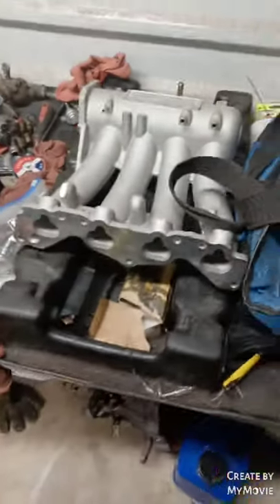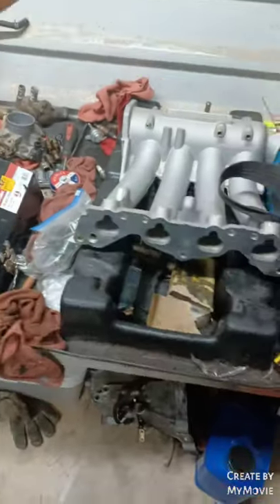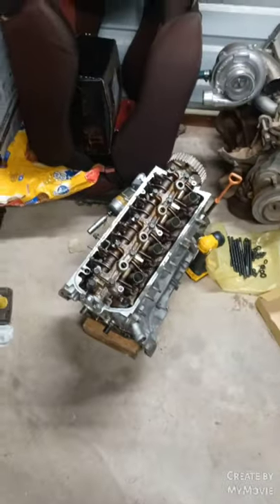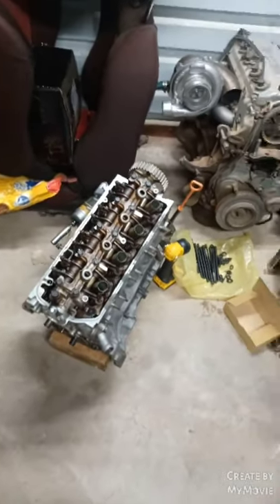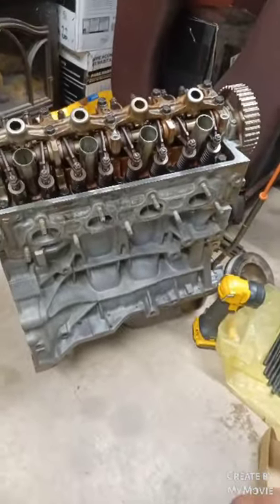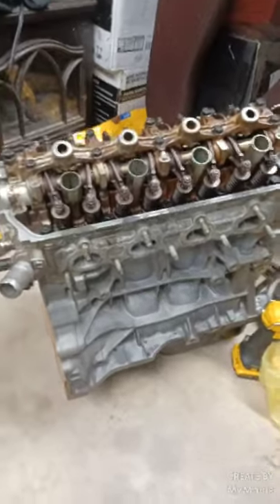After that's done, I've gotta get the stuff I need for the intake manifold — the bolts. The idle air control valve on my car is going bad so I need to replace it; I wonder if I can find a used one. Then just put the fuel rail, throttle body, and anything else — intake manifold gasket I already have. I already did a test fit on the belt, had no problem. That's it for today — like, subscribe, share, hit that notification button and let people know.